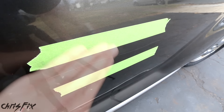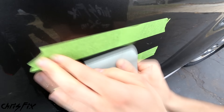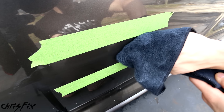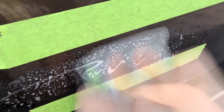Spray down the area — don't be afraid to get it soaking wet. Also spray down your sandpaper. Now start sanding along the whole line perpendicular to the scratch with medium pressure. Every manufacturer uses a different clear coat; some are harder than others. In general, sand for about 15 seconds, then check to see if the scratch is still there by wiping down the area with your towel. If you can still see the scratch, continue sanding until it's almost gone. Every once in a while stop, wipe the area, and check. If it's gone, you're done with the 3,000 grit. Be patient — you don't want to burn through that clear coat.